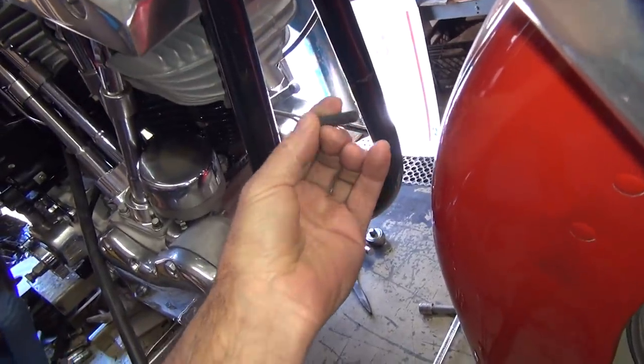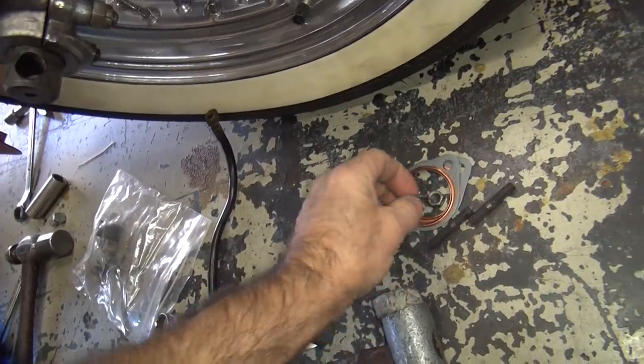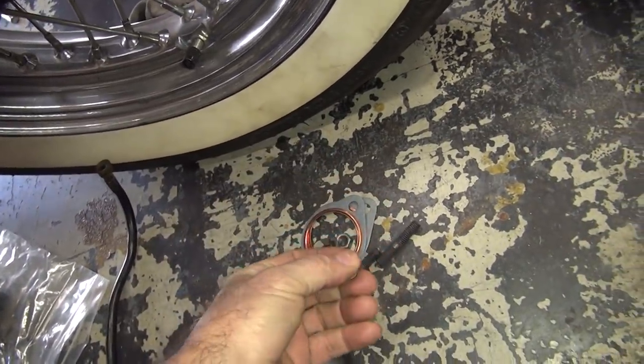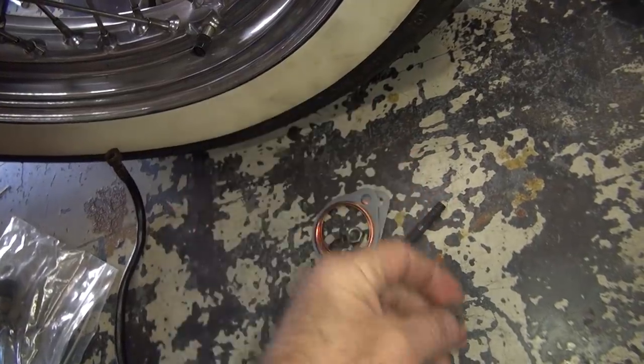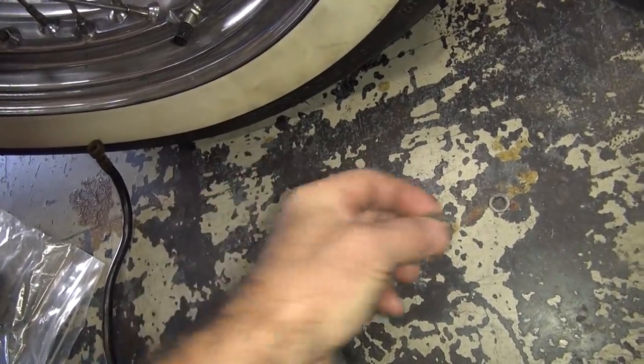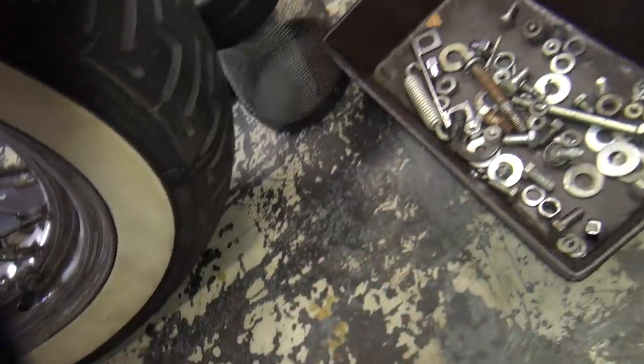Things to get done. So I got some exhaust studs here I'm going to put up there in the heads. That's a lot better way of going. It won't strip the heads out and they stay tighter longer. The key is to use a standard mechanical lock washer. That works fairly well. Except that one's dead. These aren't very good. So I think we'll get me a couple brand new ones that are a lot stiffer. Just trying to reuse some of his stuff, but oh well.